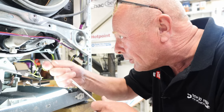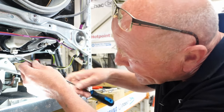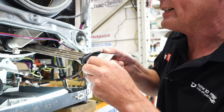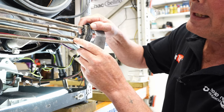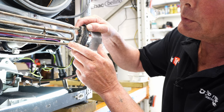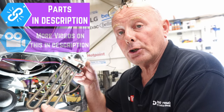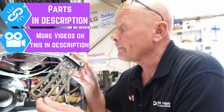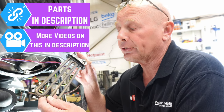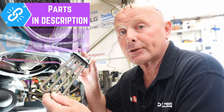I'm not caring too much about the seal on this one, because I know the element was tripping the electricity. If you look closely here, you can see where the drum has collapsed onto the heating element and cut through it, causing an earth problem. The error codes that may occur with the heating system are F20. This heater is available new at the website, and the link is in the description below to these heaters.